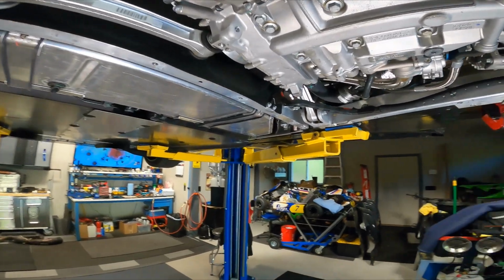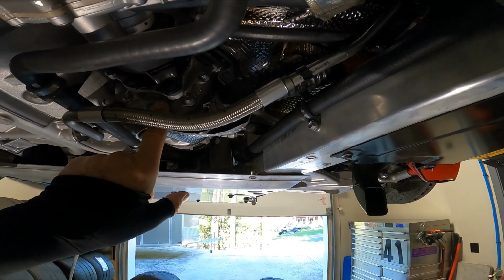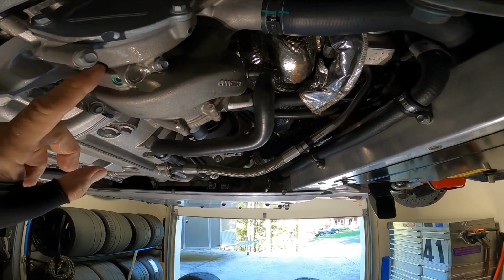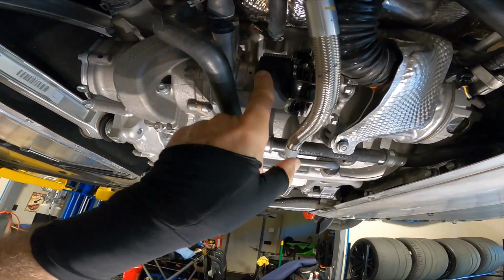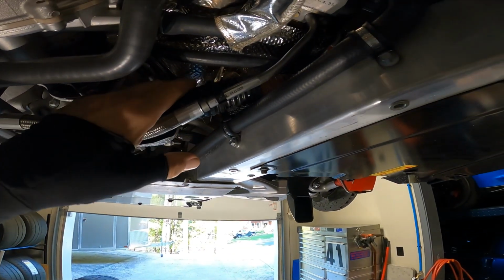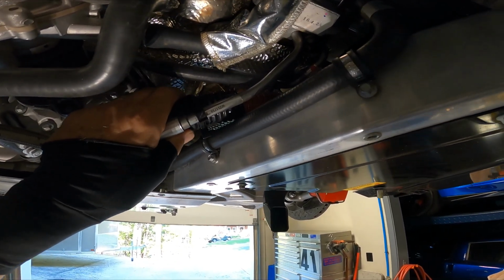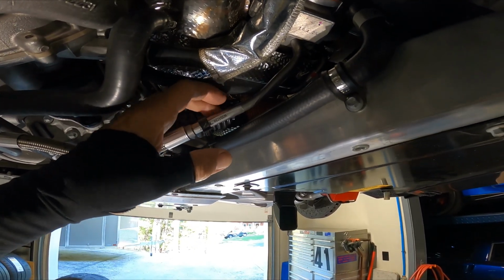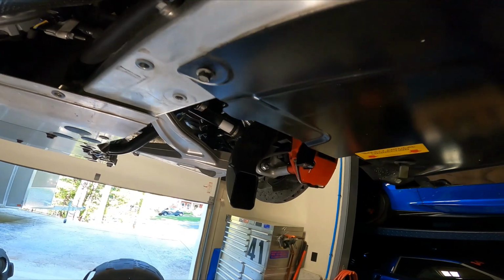The other thing I discovered, which was interesting, is that this is a hose that fits the air conditioning compressor. So what you have on this side of the engine is you have the water pump, which is driven off a chain off the front of the motor, and it's connected by a belt, and this belt is basically two tooth belts, not directly connected, but this is your AC compressor. So this is like a high temp silicone little duct hose, small one like they would use, well, bigger ones are used on brake cooling. But what I noticed is in a lot of places this had split. I don't know if it was from vibration or rubbing, but there were several places where this was starting to come apart.